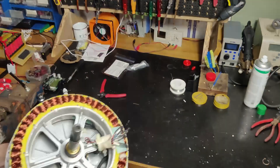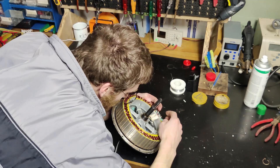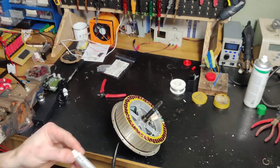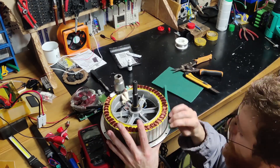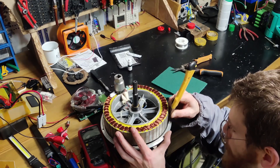This statorade is attracted by magnetic fields, so it will sit around the magnets of the motor and will close the gap between the windings and the magnets — basically improving the thermal conductivity from the stator to the rotor and the outside aluminum casing.